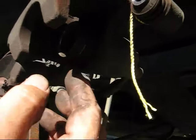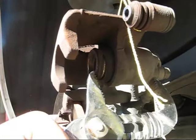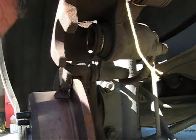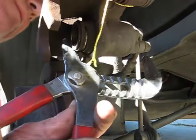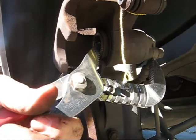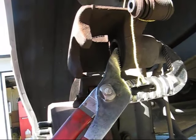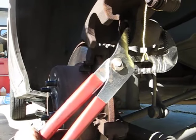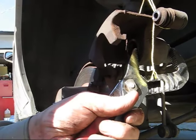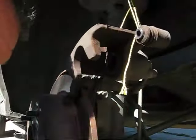We know we're going to put the brakes in, but we need to push the piston back because it needs more space. Nice and carefully and nice and slow. We've squeezed it all the way in and you'll see it's nice and flush. That way when we bring it down, it'll go right into place.